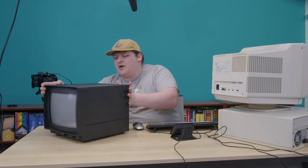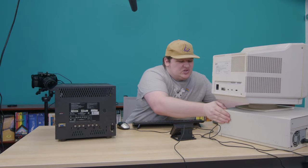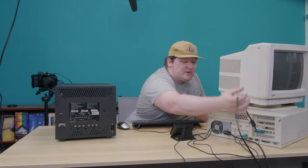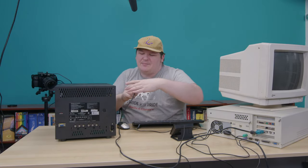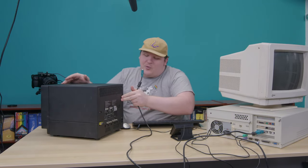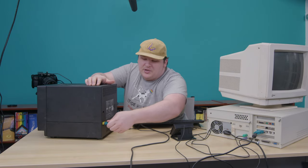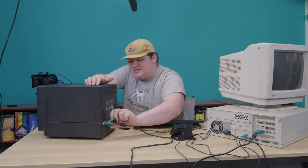I tested another one, Rambo 3, which is supposed to support this, but it only supports it on special monitors and special cards. You have to have a Paradise EGA card, one of those Super CGA types. That's that Hawaiian burger joint. And I don't have one, and I had hoped that it would work with other Super CGAs, but apparently it doesn't. So, no dice there.